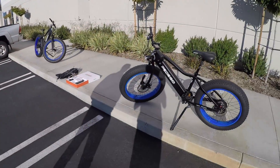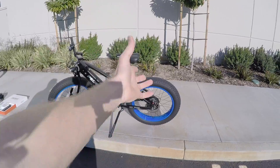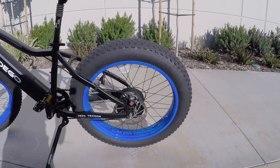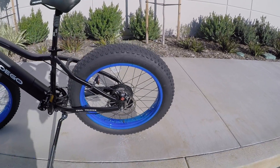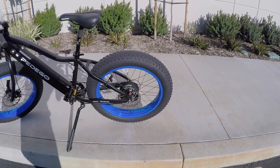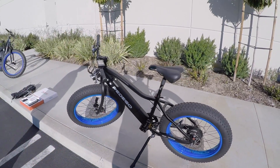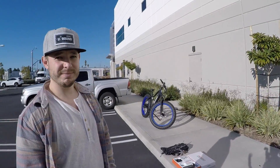It's a fun platform. The piece I like about the full-size ones like the 24 here is you've got comfort going through these tires. The inflation on these says max 20 PSI — you can run them like 5 to 20 PSI. The idea is like snow or sand: at lower PSI it spreads out and gives you more surface contact for grip, but also a little bit more float so you don't sink in and it improves your steering. These are originally like snow bikes, but a lot of people got into them as just a fun bike — it's like a stomper truck.